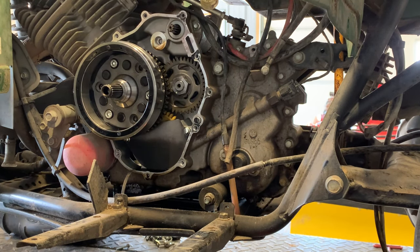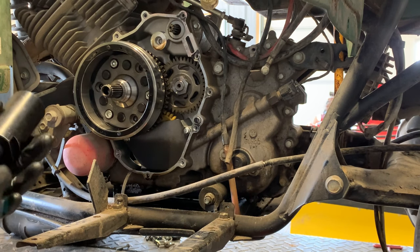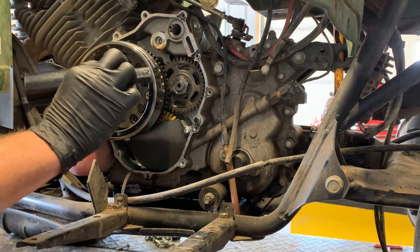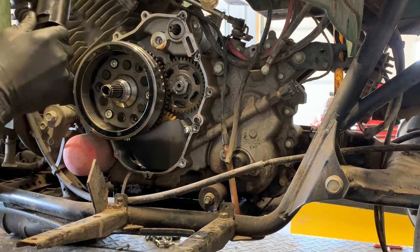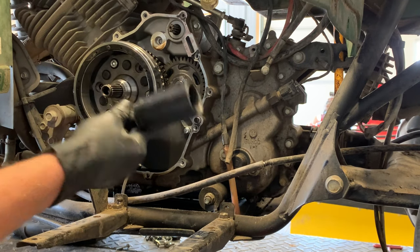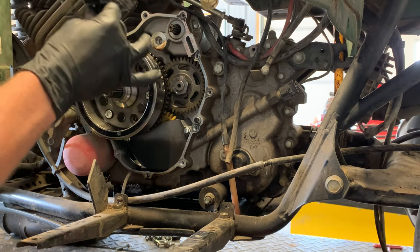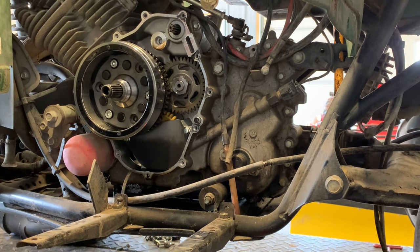You're going to need a special flywheel puller — I sell these and will put a link below. If you just search for a flywheel puller, there are literally thousands of them — different makes, models, sizes, thread pitches, shaft lengths, and bolt lengths. Not all of them will work; it's not a one-size-fits-all tool. This one is special for this four-wheeler. A lot of times people order one that looks right but the thread pitch is slightly different. If you screw on a puller that's not the exact size, you'll start cross-threading, and when you apply force, you'll pull those threads completely out of your flywheel — then you have nothing to pull against.